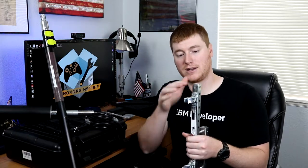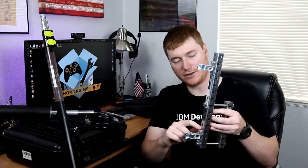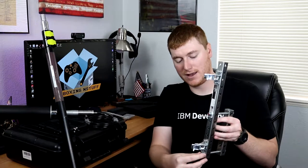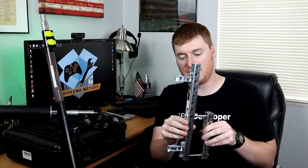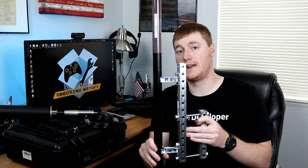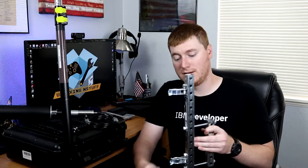And then on the front here, I used some clamps like you would use to clamp a broom or something like that into a closet, and I spaced them apart. I will mount this to the frame, and then I put regular nuts and washers on the front here, and bolted these in as well. This way I can take this on and off as needed from the outside without having to worry about the back side, the inner side there. I pretty much cut these down to an exact length, and then I'll be able to clip this pole right in place, and it's going to securely hold it in place while I'm using it. It makes it easy for me to get on and off at the campground, and hopefully easy to pack up and easy to set up.